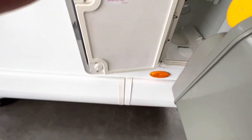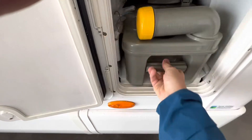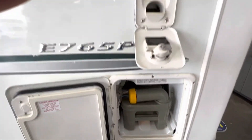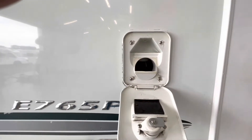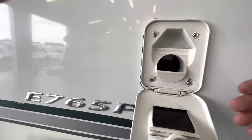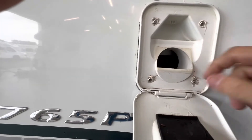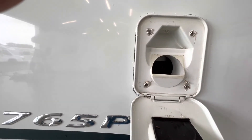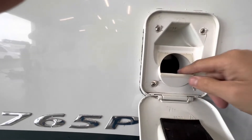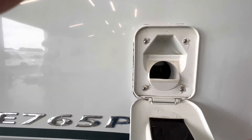Insert the cassette back in and once it's clicked in we know that's secure. This is our flush — on this particular motorhome it is a separate flush. You can add an additive, either pink or one of a couple of different colours, which just keeps everything smelling sweet. Then just fill it up with a hose pipe, but be quite careful when filling up because it fills up quite rapidly. Keep an eye on it and then lock this back up with the correct key.